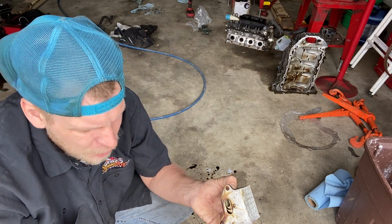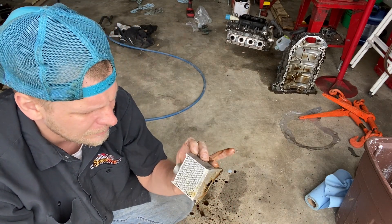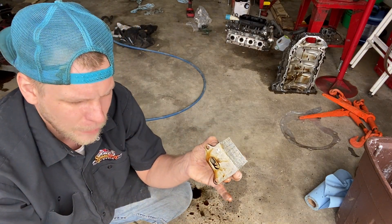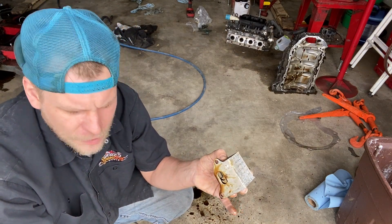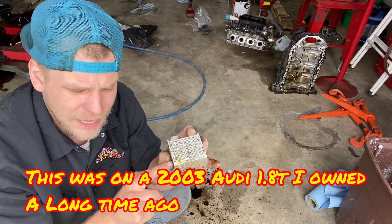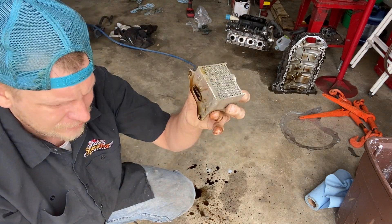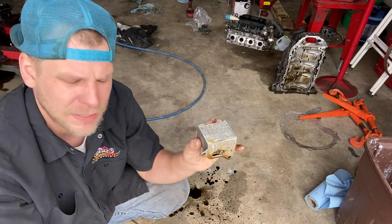On my last car that I had this going on with, I did not expect this — I did not think that was really a possibility. I put a head gasket on it first, then I put a whole different cylinder head and another head gasket on it, and then finally I figured out that it was leaking inside this oil cooler assembly. Once I simply put this little cheap cooler on it, all my problems were fixed. I hope that helps someone else out.